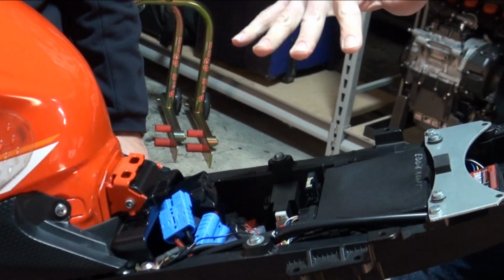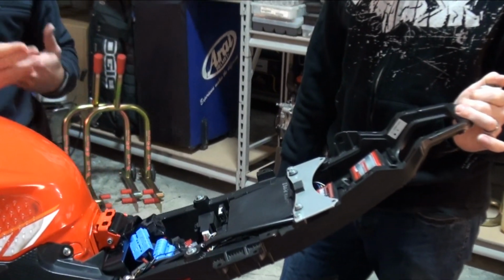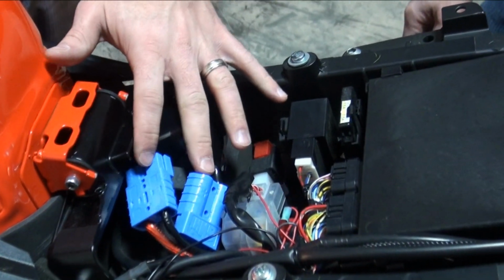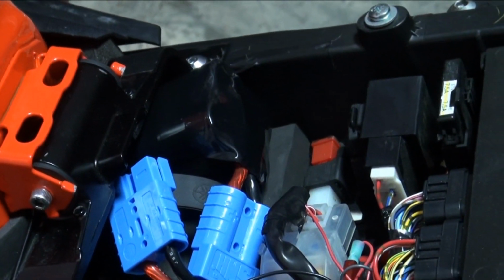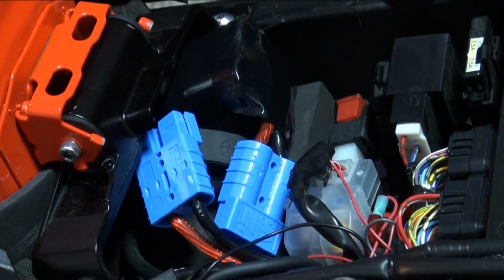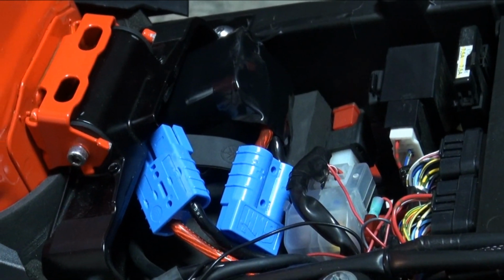Fast. And the performance is actually better than the standard battery. No maintenance. You just have to. The only potential issue is when it's cold out. It may take a little longer, but you can disconnect it, bring it inside. You can see here on my bike, we've got a quick disconnect setup, which Full Spectrum offers as well. They have some that work with a standard battery connectors, so if you don't want to mess around with it, you just hook it up as normal, or you can kind of make this work and just quick disconnect whenever you need to.